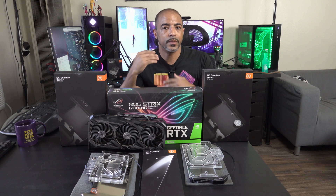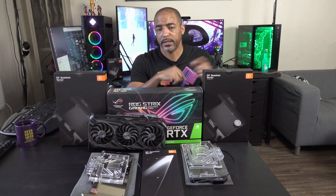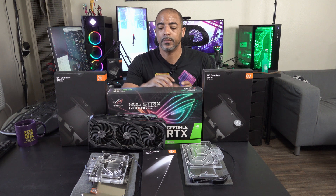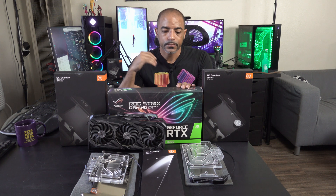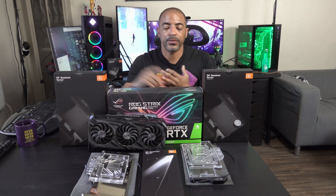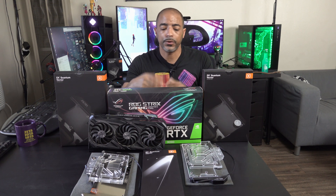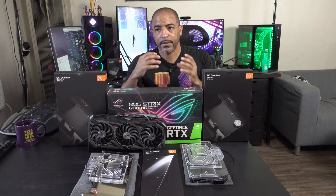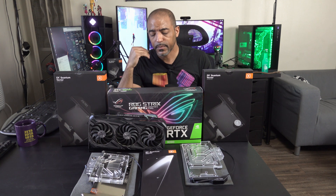If you want to see numbers in terms of how effective it is to have an active back plate, check my previous video — I'll link it in the description. For this one, I'm going to focus just on the back memory temperatures, because that's the big thing for 3090s. When you're gaming, how hot is that memory getting? Because you need a lot of airflow on that. When you're video editing, running Blender, or using your card to make money — as many people have been doing the last couple of years — that back memory gets very, very hot. So that active back plate does a wonderful job.